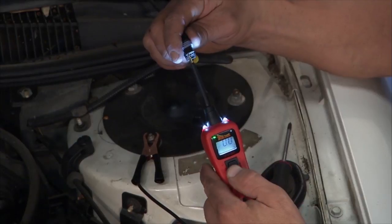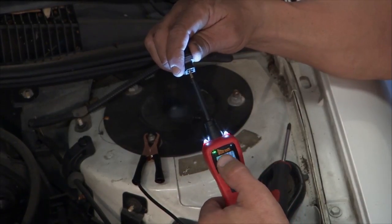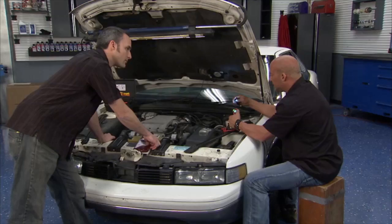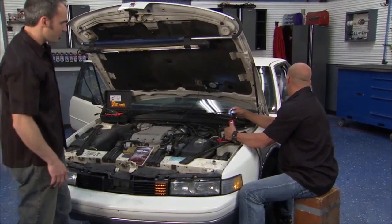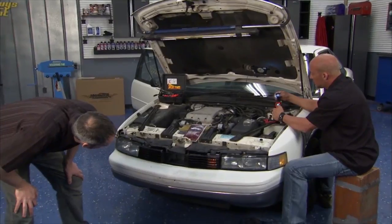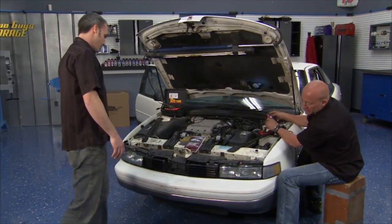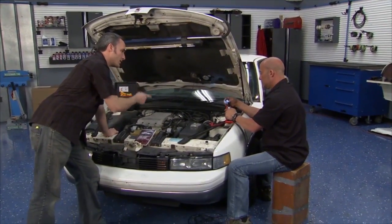Let's check the other side. That goes from green to red, so you have a ground but it's resistance to ground — not enough to flip the circuit breaker. There's a dinger too. Your parking lights are coming on — so maybe there's something more to this circuit than just this dome light and the on/off switch.